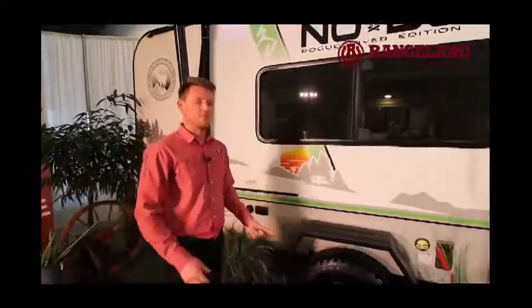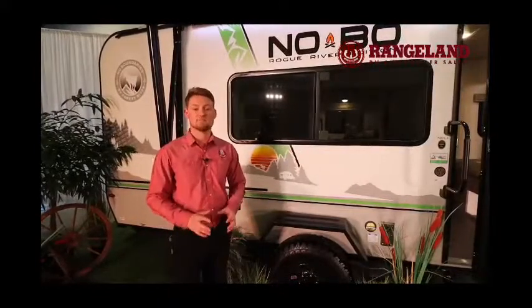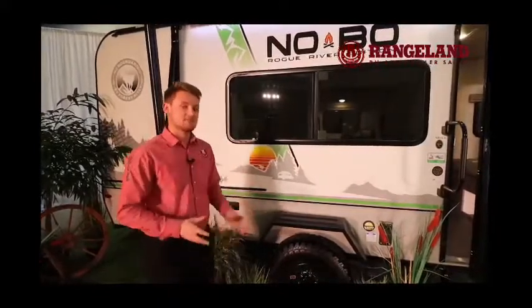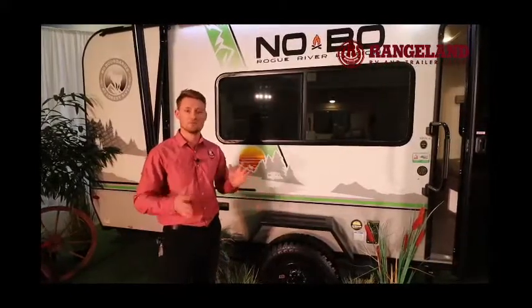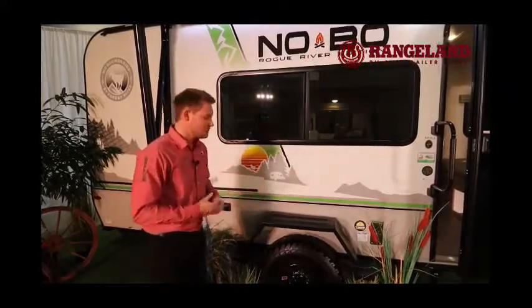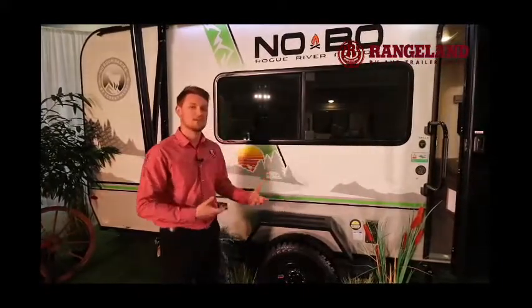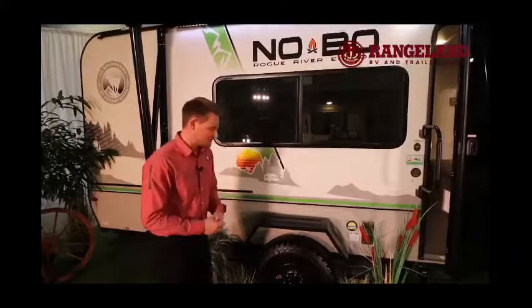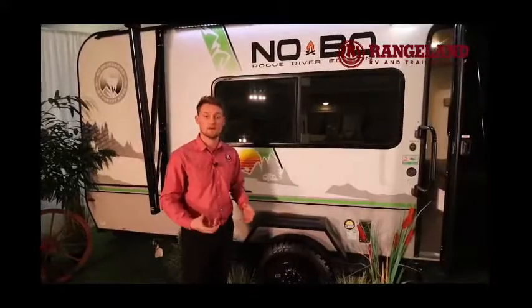Now, another thing that we're going to talk about before we jump inside is the suspension system behind a Nobo, which makes it very unique. This is what we call an independent rubber ride torsion suspension. The big benefits that you have, especially on a trailer like this, is that independence factor. If you want to take it into the backcountry where you have some pretty rough roads, it's going to roll just like the vehicle down that unusual terrain, we'll call it. Plus, they also help reduce the vibrations from passing back inside your trailer, like you may see with a leaf spring axle. Of course, Nobo with this particular package has the off-road kit on it, so you have that 15-inch off-road tire also. Follow me inside and we'll have a look at some of the cool features in here.